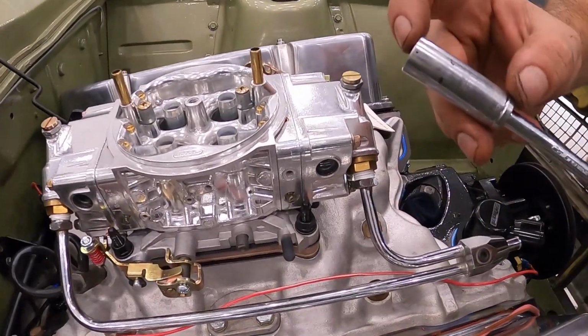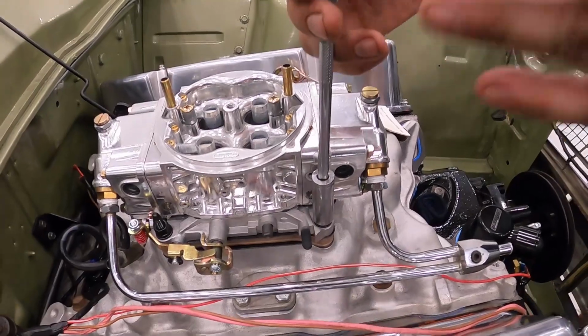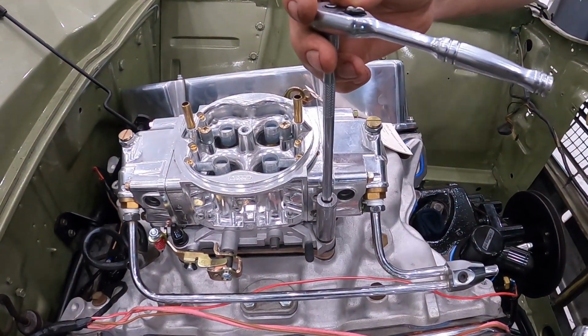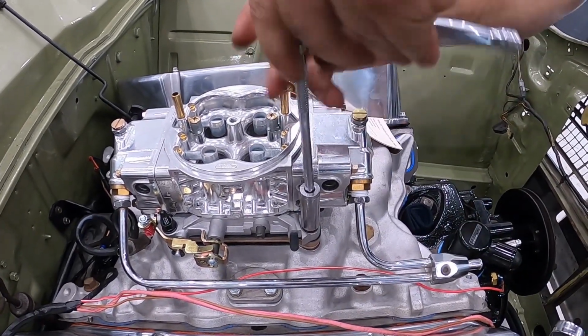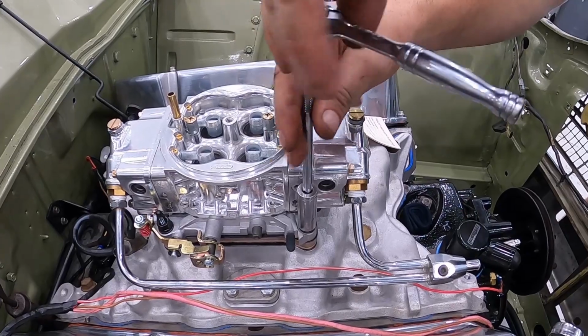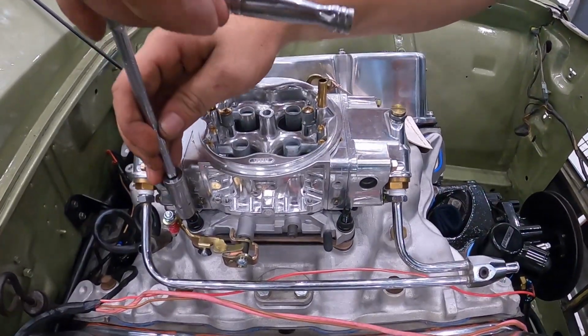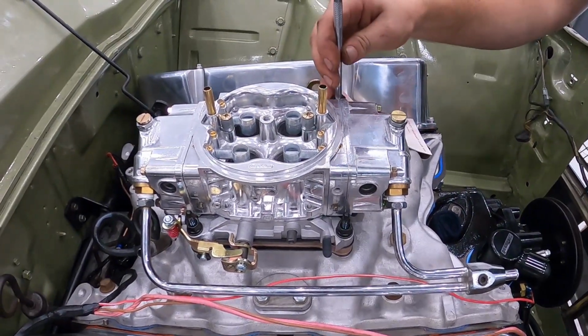So 1/2 inch, guys, deep socket because of the studs. Like this, you use a small tool, guys, and you can't overload it then. If you use the 1/2 inch drive, you just shear them off, you'll do some damage. So use a little tool, guys, 1/4 inch. Just nip it. They only need to be done up to 15 foot-pounds. Nip. So the 1/4 inch just helps you get there so much more safely and with much better feeling.